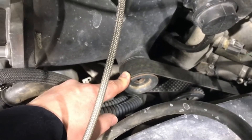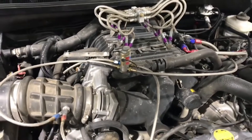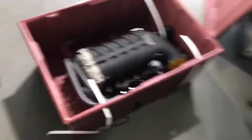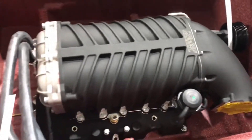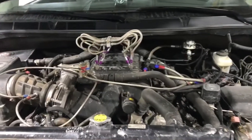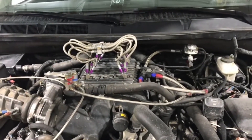This is only a 1.97 inch pulley and the blower's already over-spinning over its rated speed. But this is what we got in the mail — the new Harrop 2650 — and we're going to put it in and see how things go. I'll go over the steps of removing the supercharger and installing the Harrop unit.